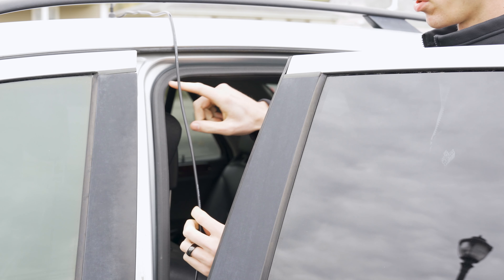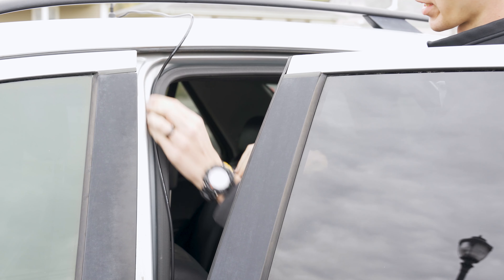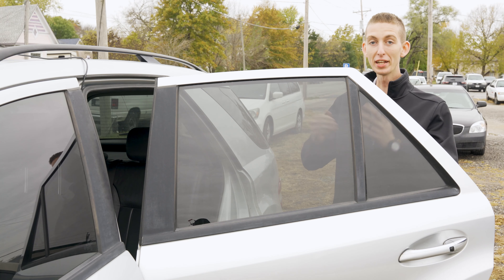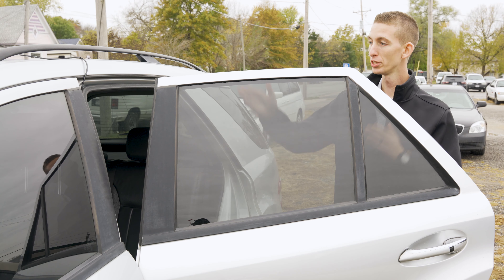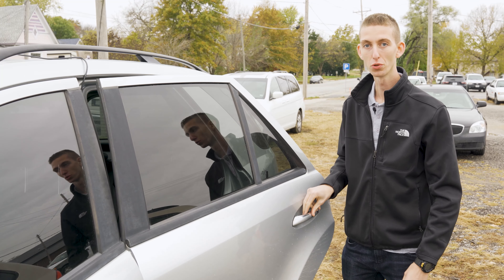Once you have the cable through here, I like to open the back door and stuff it underneath the seal. Give it a little bit of slack there and just stick it in the seal. You can do this with most vehicles — go down as far as you can, then wrap it inside. So now that you have the cable inside your vehicle, run it underneath the rear floor mat and then up to the front cabin. Putting it in with the seal means you won't have any leaks and you can use your door like normal.